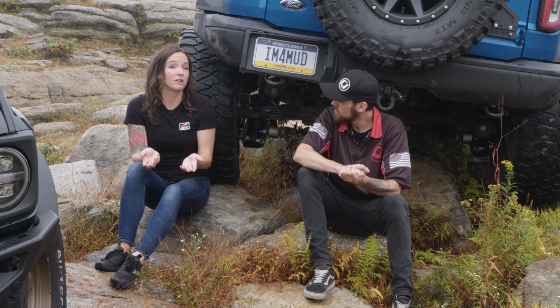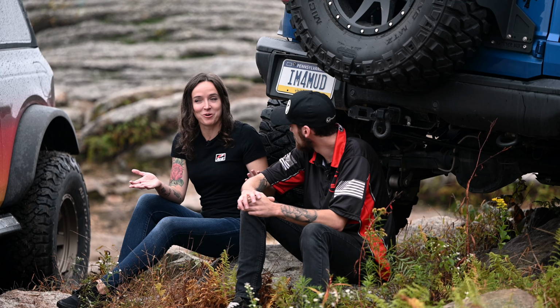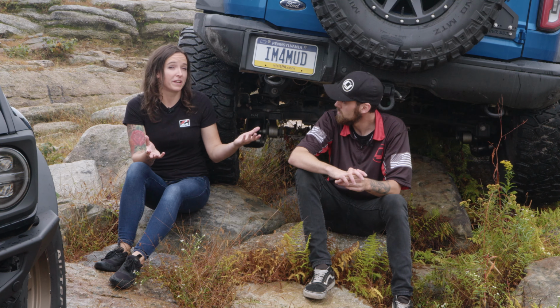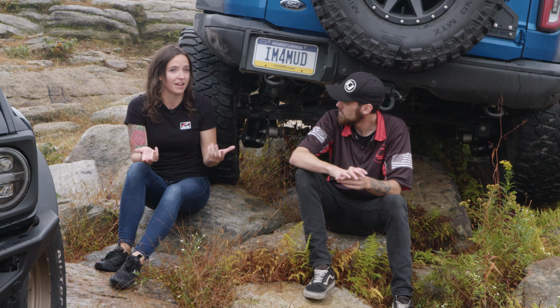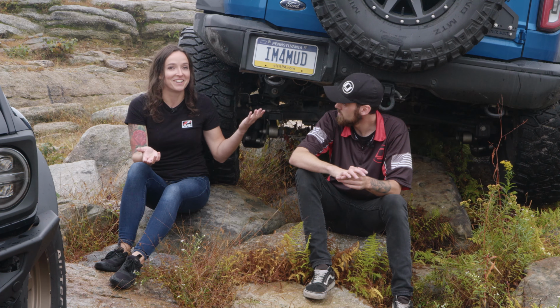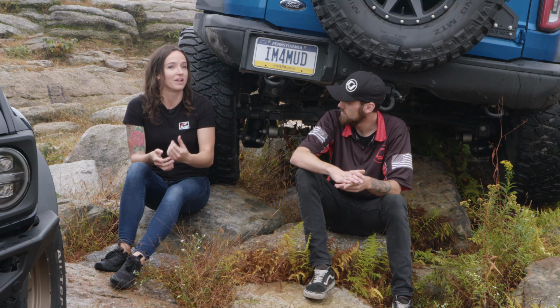Yeah, it helps with durability. It also helps us with sound as well. So obviously, this is not the biggest motor, it's not a V8. That wall thickness helps us get a nice deep tone in addition to that resonator that's farther upstream, like you were saying. So although we do want a nice high tucked exhaust, we want one that sounds awesome as well. So that's another benefit to using a high quality thick material.